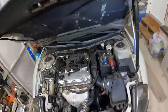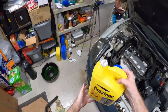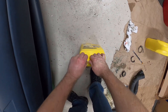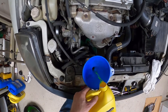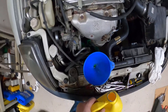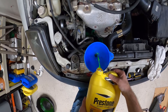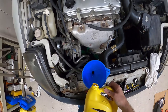Double-check everything, make sure you've got everything connected and snugged up. I have some pre-mixed coolant — all vehicles, all makes, models, years — concentrate, just add water. Generally speaking you want to go about 50-50. Petcock is closed, hoses are all connected. Start pouring this in slowly and listen for leaks. If you know how much yours holds you'll have some idea of how much to put in.